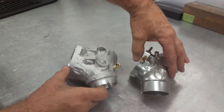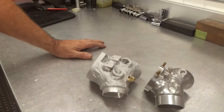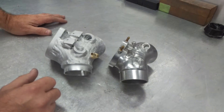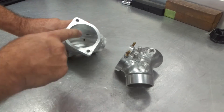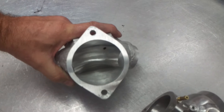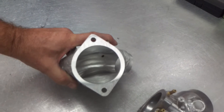One of the things that you can notice is how we've extended this manifold. As we all know, air does not like to bend, so that's why this has all been welded here. We've basically started the short bend of our port at the manifold. And if you get a shot down that manifold, you can see how we've continued the cross-section of the port clear into the intake inlet on the head.